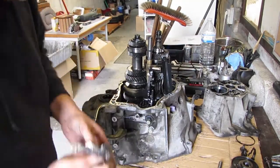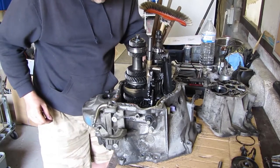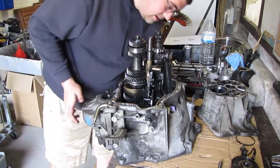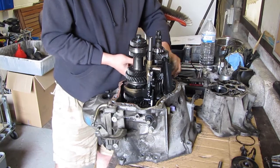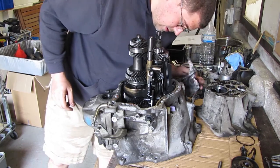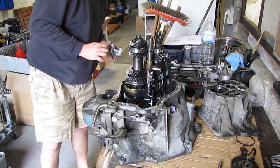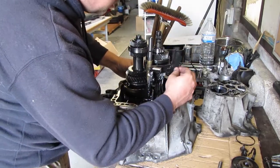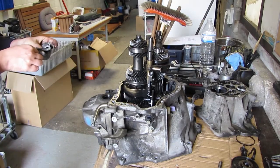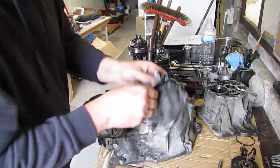Put my tools aside. The shaft for the reverse gear should lift out — it's not only a shaft but a gear as well. And then there's this fork. Also take this off — this is to guide the oil. I don't think anything dropped. So this is just an oil guide.